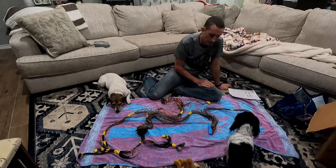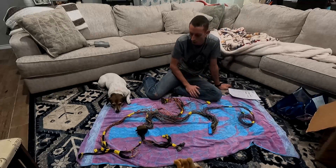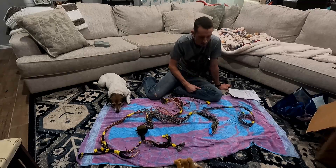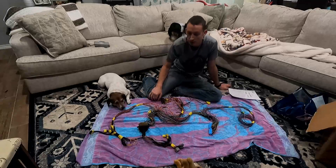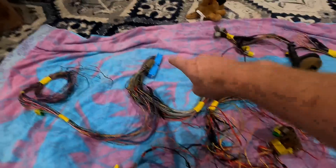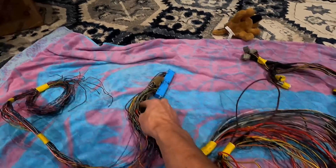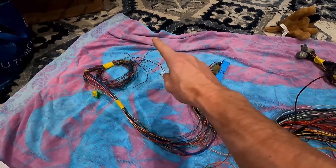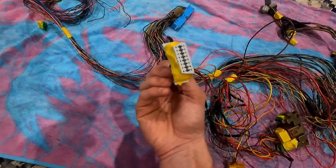We're going to go through these and see which ones we need to keep or which ones we can clip a little bit shorter to save on some space. Some of these we don't need for our application, but we're going to go one by one just in case. Let me bring you guys in — we're going to go through all these connectors one by one. First thing, obviously, we kept our ECU connector — this connects to our computer with all the pins. We also kept our OBD2 connector.